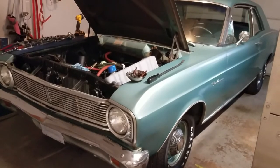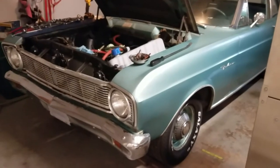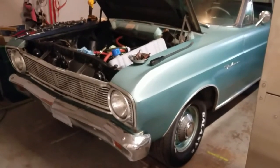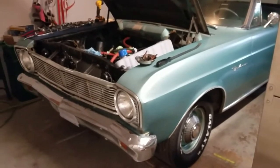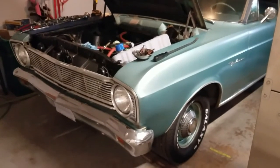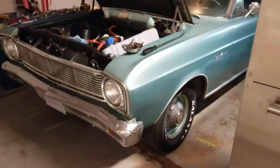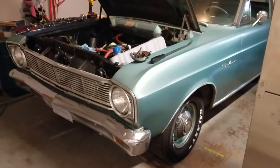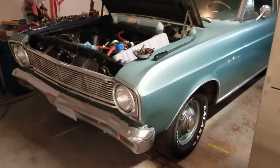I don't think I mentioned it in the last installment, but the steering was really, really hard on this thing. I popped the two front wheels off, started looking around and greasing things, and realized everything under there is ancient — all the rubber boots are split or gone. I asked myself why I'm putting good grease into parts I'm just going to throw away. But after greasing two ball joints, when I pulled the car out again the steering was way better. The problem was simply no grease in the front end — it hasn't been greased in forever. But we're still going to have to replace everything up front.